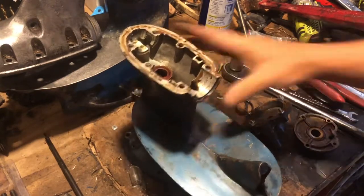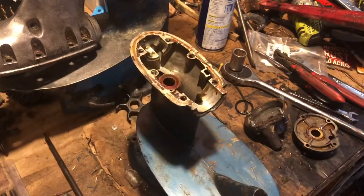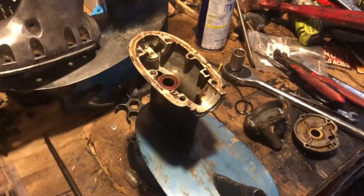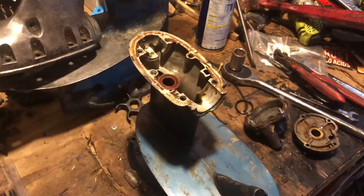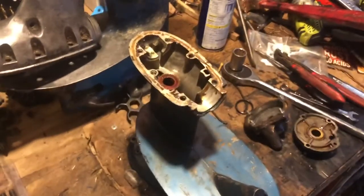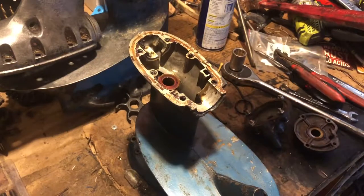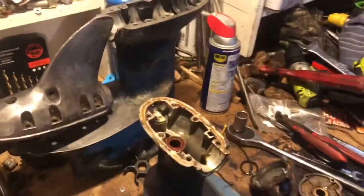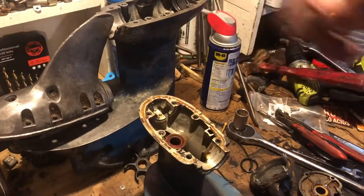For the future owners too — trust me, if you ever want carefree maintenance or bring it to your mechanic and he doesn't have to say he had to replace broken stuff. The shift rod — on the 30 horse you pop the shift right out, flip the skeg upside down and pop it out that way. But this one's the other way — sometimes the bushing needs to come out vertical, sometimes flipped upside down.